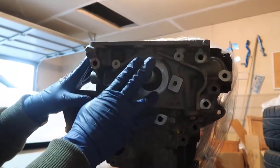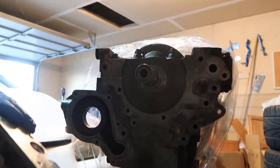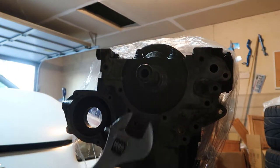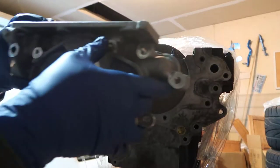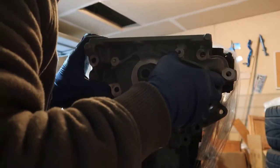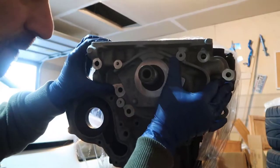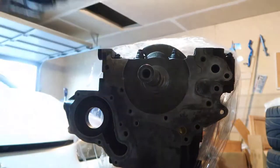So if yours is not, you take it out, turn your crankshaft with a wrench like this, right? And then keep turning until you get your pump. Or you try to put the pump there and test fit to see if it's going to get in there. There we go. Yep, so I did it three times. I guess that's a good proof